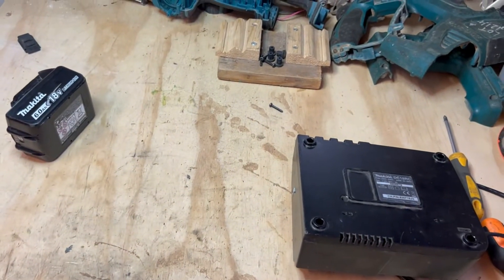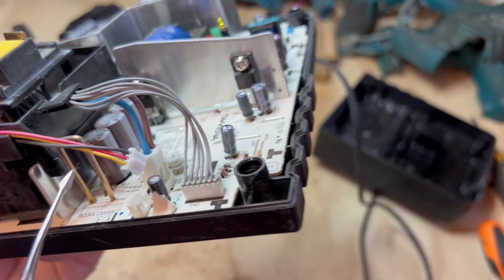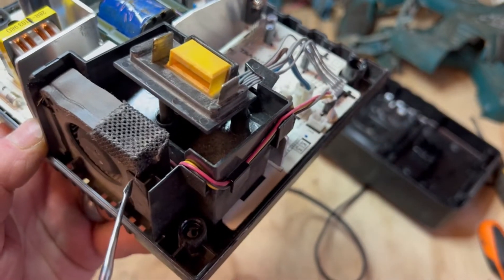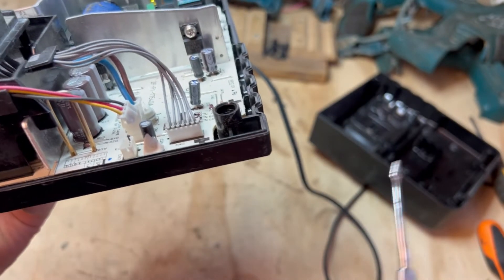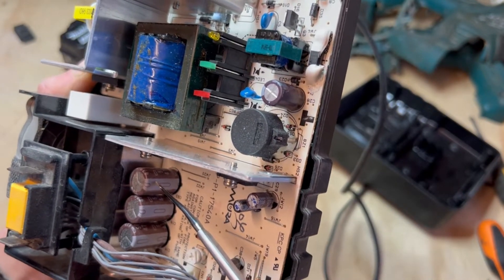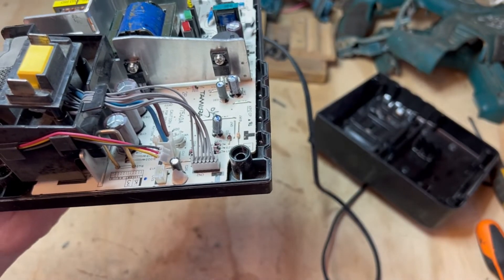Right, we're in - this could be an easy fix. When I took the top casing off, look at that - a connector wasn't connected! That's supposed to go into that little connector there, and that wire goes into the fan. So the fan's not working because the connector came loose. The fan itself spins freely - it hasn't seized on a bearing. Everything else looks okay; nothing burnt out as far as I can see. I can see a capacitor, diodes, and that's a transformer.